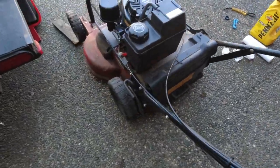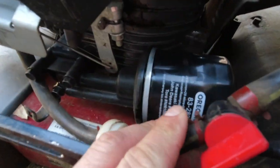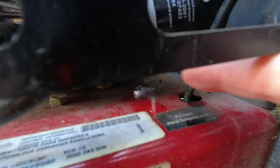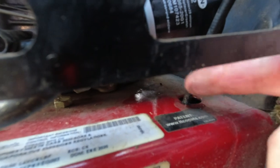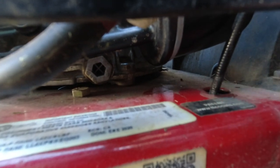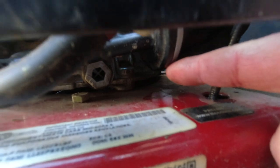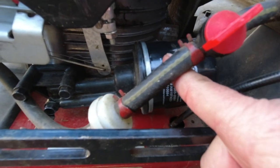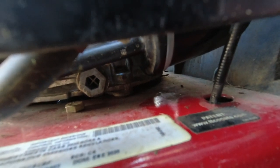Looking at the new oil filter on the other side — you can see underneath there are no massive oil spills or anything. It's still pretty dusty on here; otherwise I'd be covered in oil if I hadn't used an oil pan. There's not a lot of clearance, so using an old discarded container cut thin to slide underneath the front lip works well. The oil filter is angled forward and slightly down, so as you're loosening it, the front edge where the filter meets the housing is where it starts to leak — having something to capture that oil makes it a super easy and clean job.